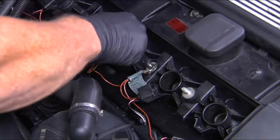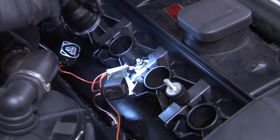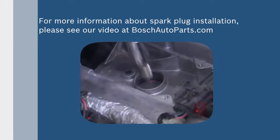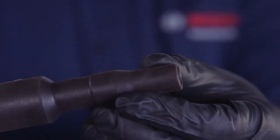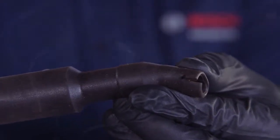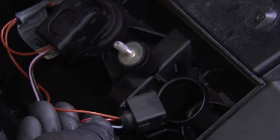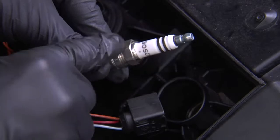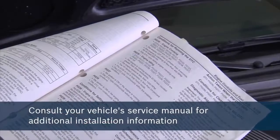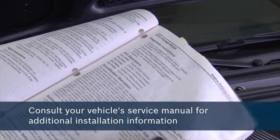This may be a good opportunity to check the valve cover gasket for leaks and/or replace the spark plugs with new Bosch spark plugs. For more information about spark plug installation, please see our video on the Bosch Auto Parts website. Before installing a new ignition coil, check for cracks or damaged sealing lips between the connector and/or plug. You should also look for corroded connectors or parting area breakdown on the plug insulator, including any evidence of burning or scorching on the insulator between the plug connector and the plug hexagon. Before starting installation, consult the vehicle's service manual for additional information.